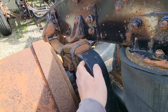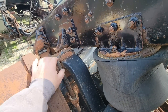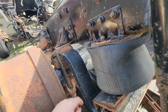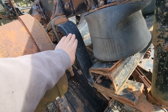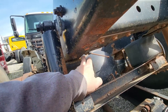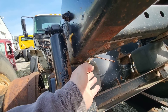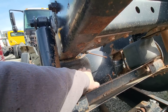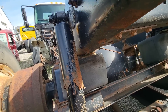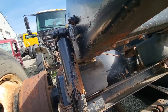The leaf spring is quite a bit thinner than that big stack that Link made, which already increases our amount of travel. We're only about an inch and a quarter thick right here. Every suspension manufacturer has a spec for the distance from here to the bottom of the bump stop - that's their working travel. This one comes down, drops real nice, flattens out, and gets the bag underneath the frame, which I like.